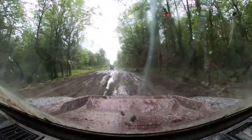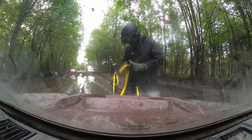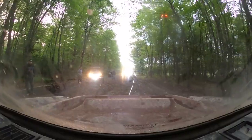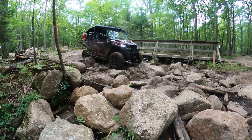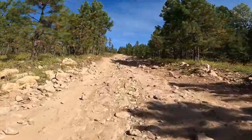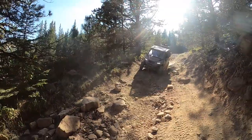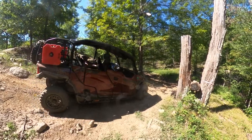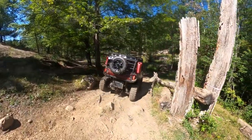The Terabytes have done well in the mud. We aren't mudders — we don't go looking for the biggest mud holes — but as we've needed to pass through thicker, deeper mud, the tires have done their job getting us traction and clearing mud from the tread. We've only ever been stuck once, and that was because we high-centered on a really deep muddy rut — I don't think tire choice would have helped there, aside from running a much larger tire. On rocky terrain the tires have also done really well. On our Black Hills trip and a few other places, the tread pattern puts more rubber in contact with the terrain and really helps grip the rocks and pull our machine up over them. Traversing down steep drops, just creeping the machine an inch at a time, the tires held on to the rocks really well, allowing us to control our descent and gently set the machine down.